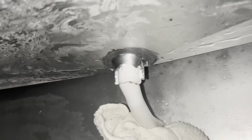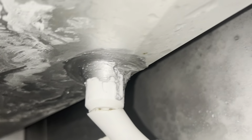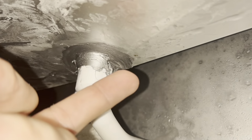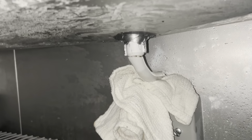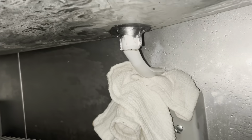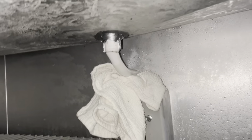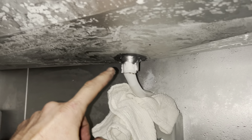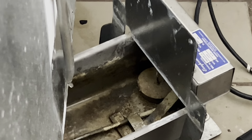You can't shortcut this process. I've got the silicone all the way around, nice and smooth, and then I've got a towel balled up and jammed in there pushing upward to hold it in place. Tomorrow they'll just yank that out and it'll be set. I'm going to give this 20 minutes or so to cure as much as I can, then put it in a defrost because there's still a bunch of ice in there. And — Eureka! There she goes. Drain line clear.